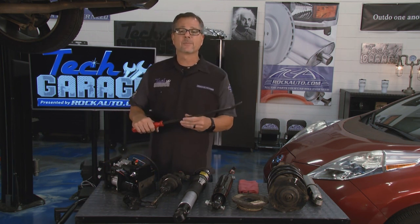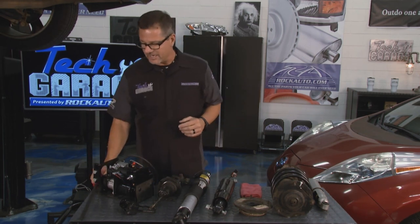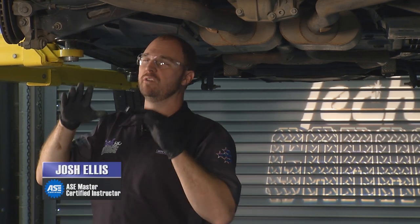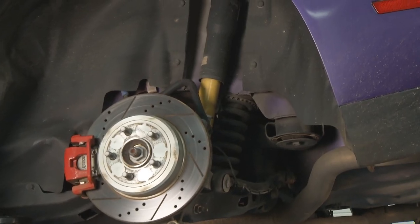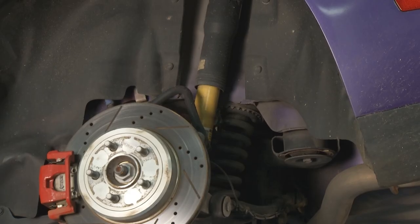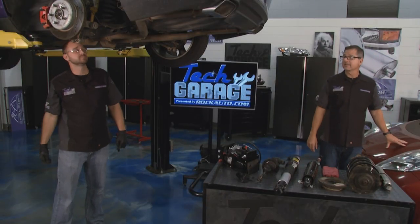Rock Auto's got us covered — they got them all. Now, I told you before there's no place for a pry bar at Tech Garage. All right, I lied — a pry bar is great when it comes to suspension. Just pull, tug, look, and a visual inspection never hurts. What you want to do is look at the shock — look for any kind of leaks going on. If you have a severe leak, that's not good for your ride. Also, give it a little jerk, give it a twisting motion — if it rattles around, the bushing is shot in your shock. This one has over 50,000 miles, looks good, but we're going to replace it anyway. Rock Auto will hook us up and we'll get that thing riding like it's supposed to.